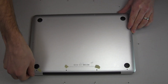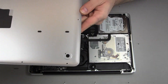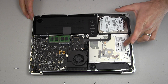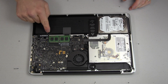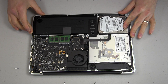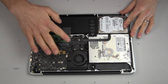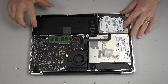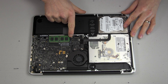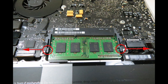I'm going to carefully peel the top off. As you can see, here's our hard drive, DVD drive, and our memory is right here. I'm going to touch the frame again just before I start touching the components. You want to touch as little as possible — don't touch the circuit board. There are 2 tabs in here holding the RAM in place, one right here and one right here.